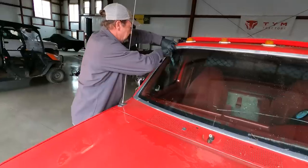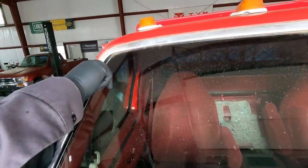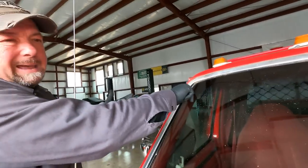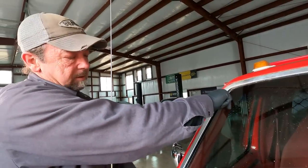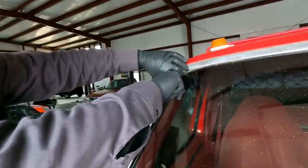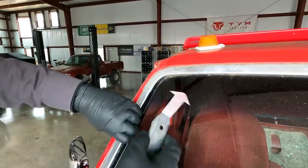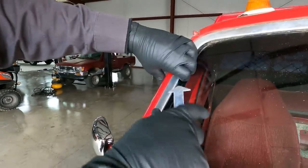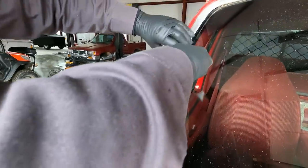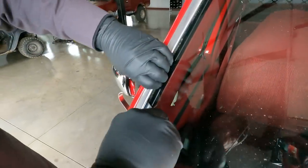Now what are you doing, Doyle? So we're gonna take off this removable chrome — most modern-day cars now have a molded-on trim. A lot of those are called encapsulated if you have one with a rubber mold, and a lot of them now don't have anything on them, just bare around the edges. But these have the old-school chrome and you just have to get the little tool in there, catch the chrome clips, and gently — sometimes they pop right off and sometimes they don't.